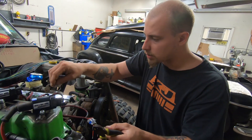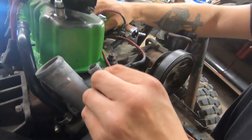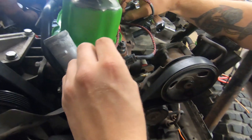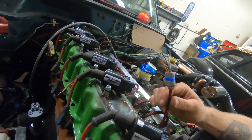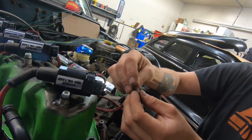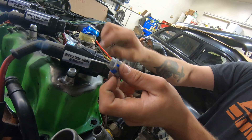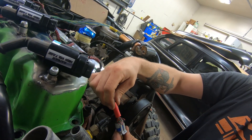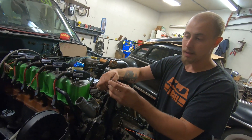Let's see what Jeff's up to over here. Slowly but surely, we are splicing together the coil packs. It got a little prettier — all we have to do now is put our pins on there, pull this up, click them in, and give it a little heat shrink to make it look clean. Let's hop on that.